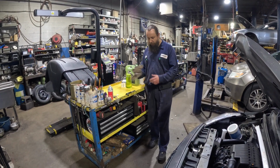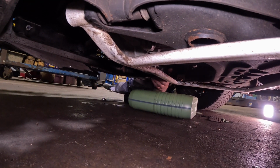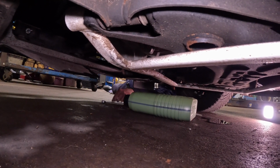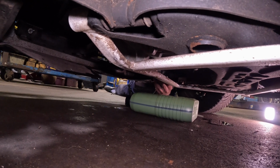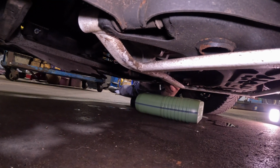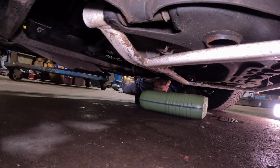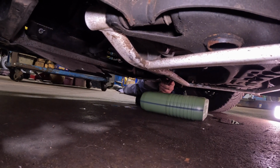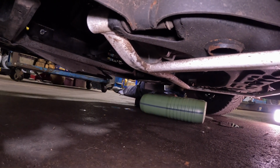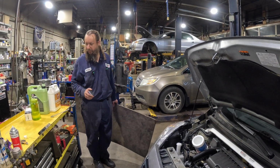Now we're gonna go and close the drain plug. So we run it in with our fingers and then just use the wrench to tighten it. Good. Now it's nice and tight. We can also pull out our oil. We are ready to finish tightening that filter.